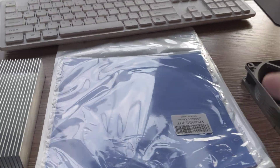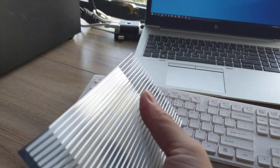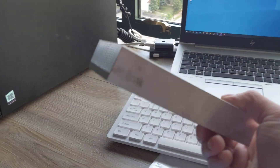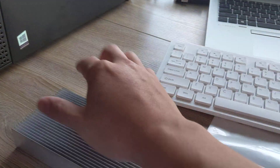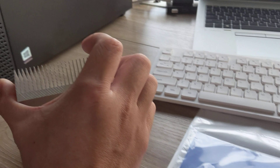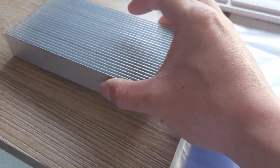Each graphics card is different. These are the actual ones I bought — these are the heat sinks right here. Pretty heavy. This is where the heat transfers, and these fins, if you have a fan or airflow going through, will extract the heat out quickly. And these are the pads — you can get all of these on Amazon.